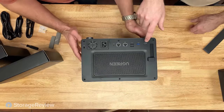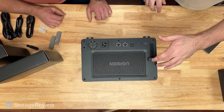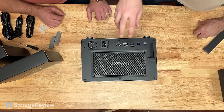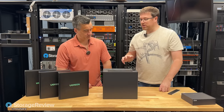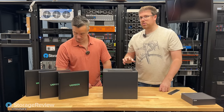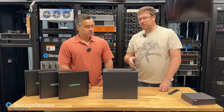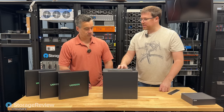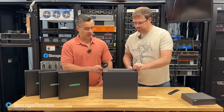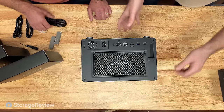While we're back here, let's talk about the ports. We've got HDMI out — I think it has up to 8K video. There's a PCIe expansion slot, two 10-gig ports on board. When you're looking at some of the competition out there, you'll see 1-gig pretty often, or 2.5-gig, or 10-gig with an expansion card. This guy's got 10-gig on board, plus a couple USB ports, embedded power supply, and a Kensington lock.